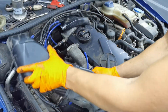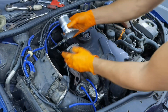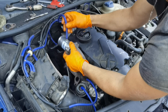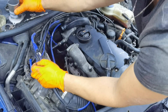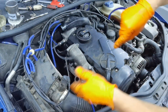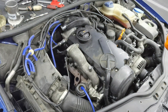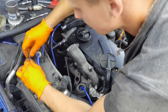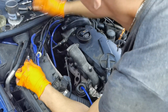Normally on the original EGR valve you'll have two vacuum hoses — one is for the throttle body and the other one is for the EGR acceleration. On the EGR delete kit you'll only have room for one hose. So I recommend removing the hose coming from the air filter box completely, and putting one screw into the little hose left on the sensor to block air from escaping or entering. From there you install the rest of the parts as before, just with different screws and different washers.